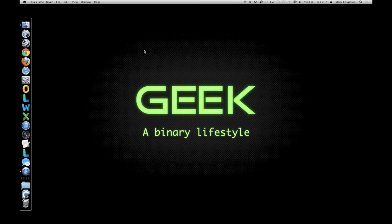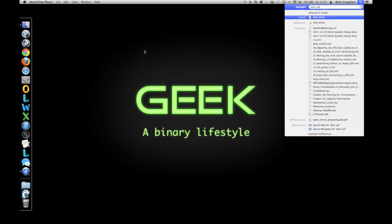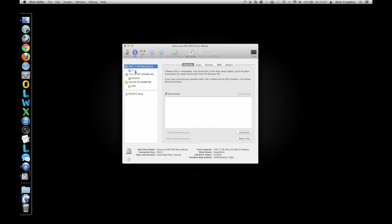So what we're going to do now is prepare our new drive and clone our old OS X setup to the new drive. So first thing we need to do is partition it. So pop into Disk Utility. There we go, find your new drive. Mine's there. Mine's already got a partition on called blank, but yours may be actually blank and not have any partitions on at all. Select partition.